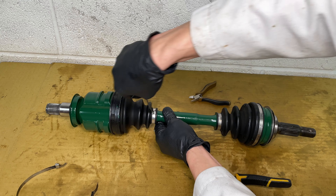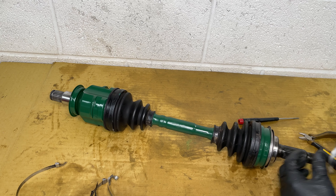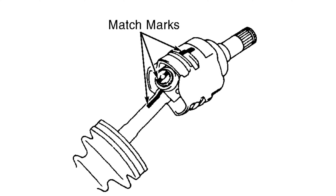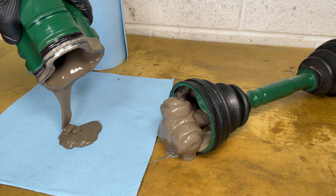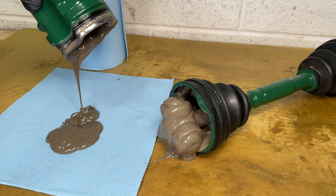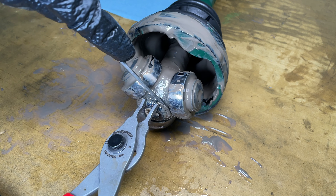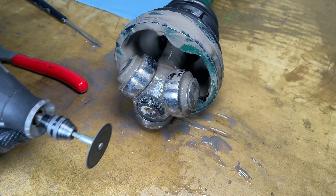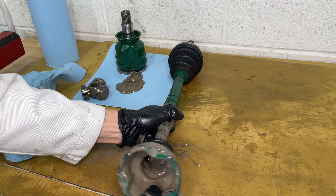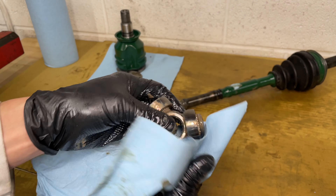I'm just going to fast forward through this part — removing the clamps from the front axles is exactly the same procedure as the rear axles. Pry open the tabs, cut the clamps off. Toyota recommends marking the outside of the CV joint as well as the inside so you can match the wear patterns between the tripod joint and the tulip. Pull the boot off the inner CV joint first. This grease looks a bit different — it melted because the inner CV joint is always touching the transmission so it gets almost as hot as the engine every time you drive. That's okay, this grease isn't bad, just a bit runny. Use the snap ring pliers and a small flathead screwdriver to remove the c-clip. Mark a line going through the shaft and bearing carrier so you can put it back together the same way. Slide the bearings off, then the boot can come out too — I'm just going to throw that away. Use a lint-free paper towel to clean up as much of the grease as possible.